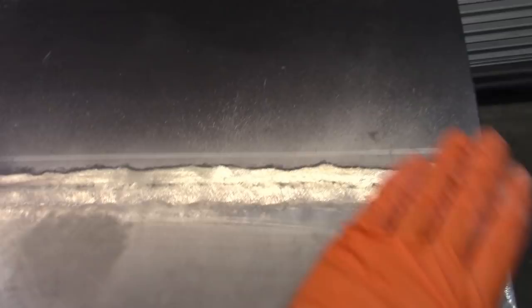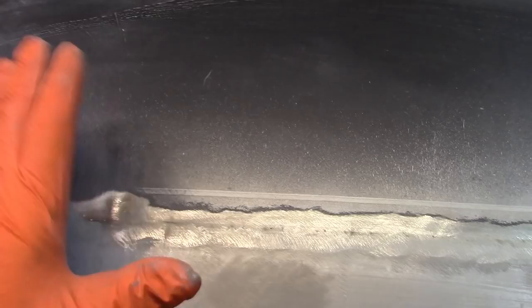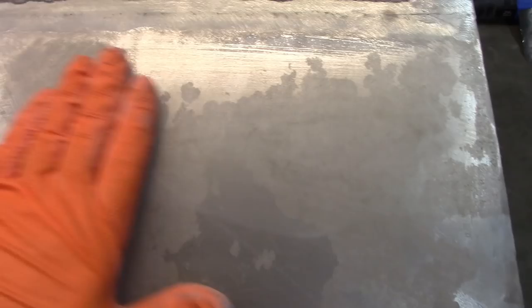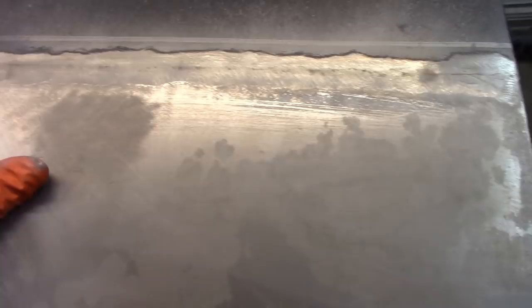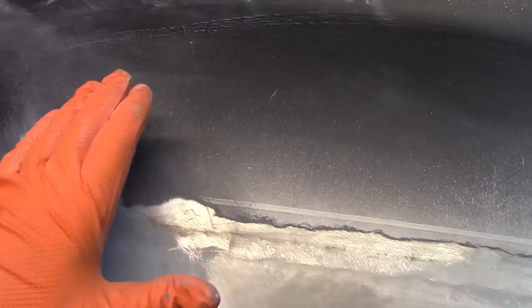And you know, there's always debate about using epoxy primers on top of or underneath body filler, and I've read many forums that go both ways. Ideally, and this is just my perspective, you want to put filler directly to bare metal. And in this case, this metal has been treated and protected with that 3X chemistry product. But the debate goes on about whether you put it on top of epoxy or not. The instructions will tell you that you can go directly on top of OE paint, and I've done it both ways.